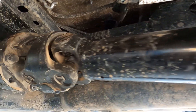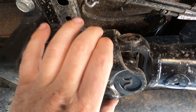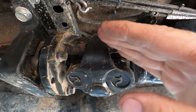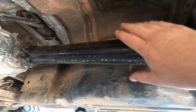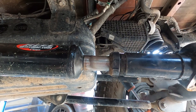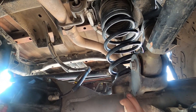You can have a double Cardan joint like this one, where you have two individual U-joints and a spherical ball in the middle. This joint increases the amount of working angle that the drive shaft can operate at, to where a single U-joint can't operate at that great of an angle. If you run a design like this that doesn't have a slip yoke at the output, you need some sort of plunging method — and that's what this section in the middle is for: the ability for the drive shaft to go up and down as the suspension cycles through its travel.